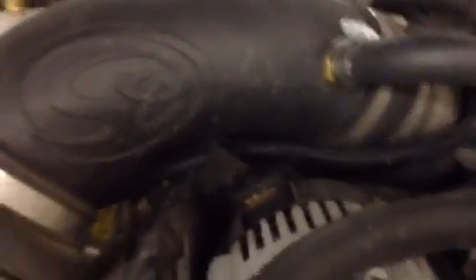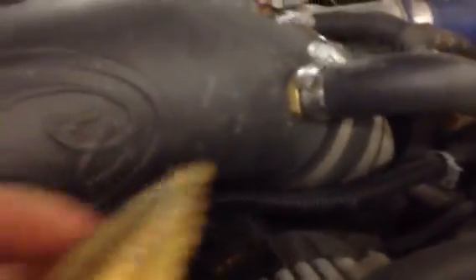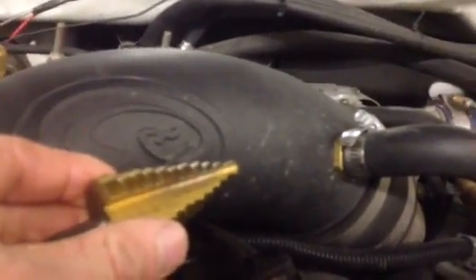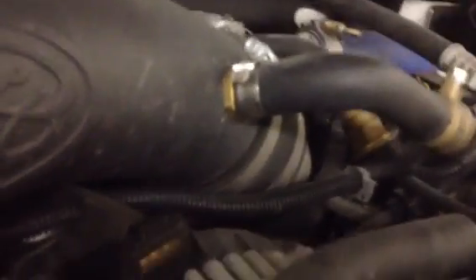For the intake fitting — the brass fitting — take off the plastic piece of your air intake completely so you don't have to worry about getting shavings in the intake. Drill a pilot hole, then use a stepper bit to drill the hole out until it's just a little bit smaller than the brass fitting. That way you can self-tap the brass fitting into the plastic and it will be secure and clean. Make sure you get any plastic shavings out of that tube before you put it back on.